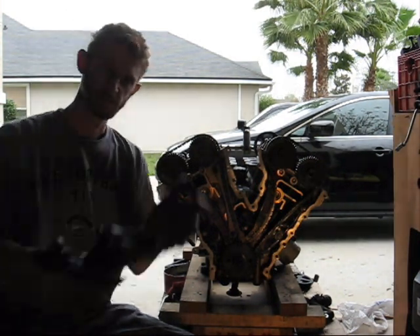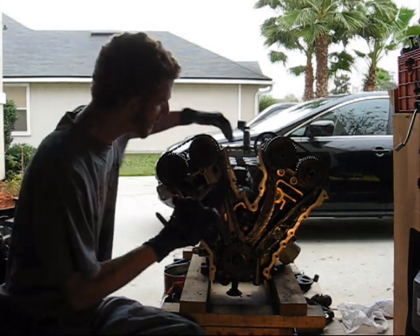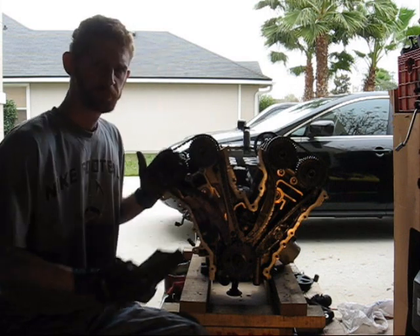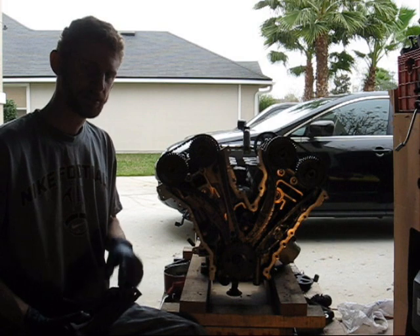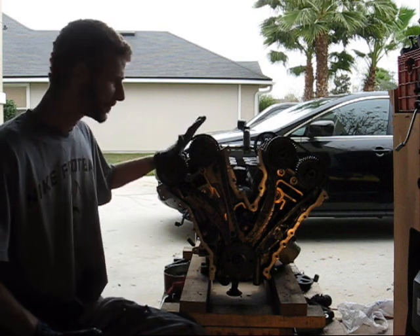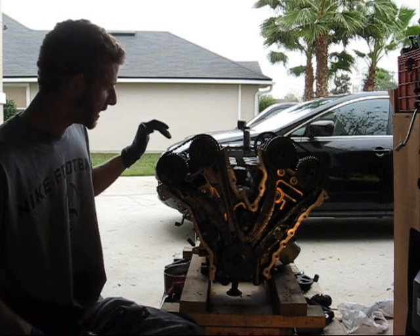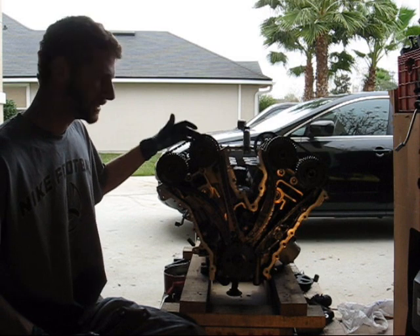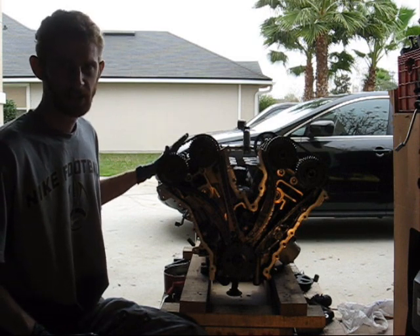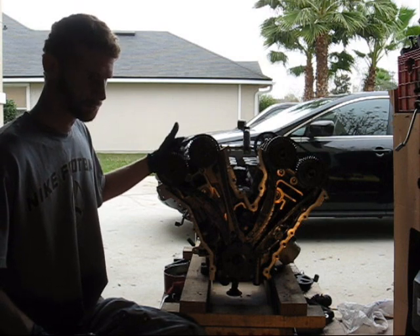The first thing is this engine mount. This is from the Ford Escape, and this mount bolts to the block right between the heads. In stock form, the only way to get this mount in or out is to remove one of the heads. In order to do that, because this is an overhead cam engine, you have to remove the timing chain, the cam shafts, and then as soon as you crack the head bolts loose, you have to get new head bolts and a new head gasket, because they're torqued to yield bolts.